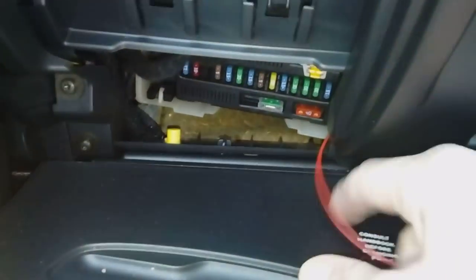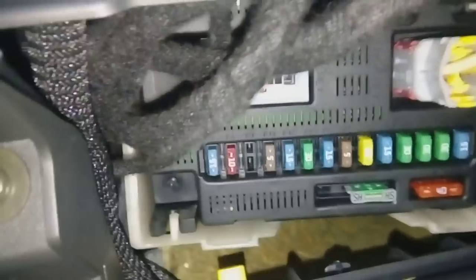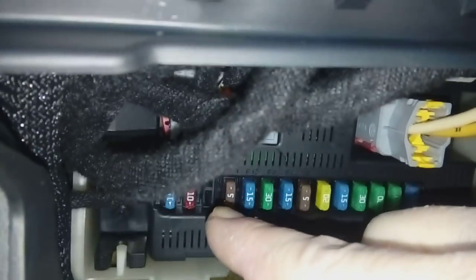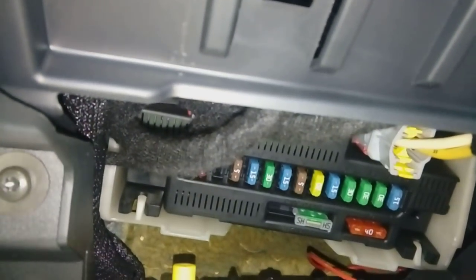Run your red power cable down, tape it or tie it up, all the way down and drop it underneath the glove box. There's a foam pad under here on little plastic clips — run your red power cable up along the glove box and bring it out to the fuse box entrance. Next to the red 10 amp you'll see a 5 amp brown fuse — plug it in using a fuse spur so you can double up the socket and run power from there.